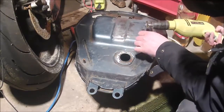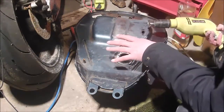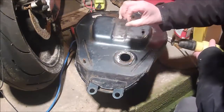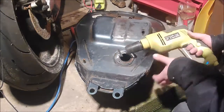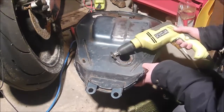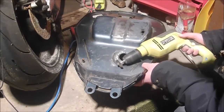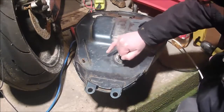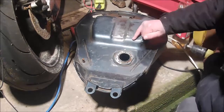Right in these seams, I think we're going to get right down, and again, because nobody sees this. This is obviously under where the engine comes up to. So I'll probably be using quite a thick black paint, and give it a proper lacquer underneath. But for all the little spots that I'm seeing, I think we just bare metal this whole bit, definitely. Absolutely bring it right back.